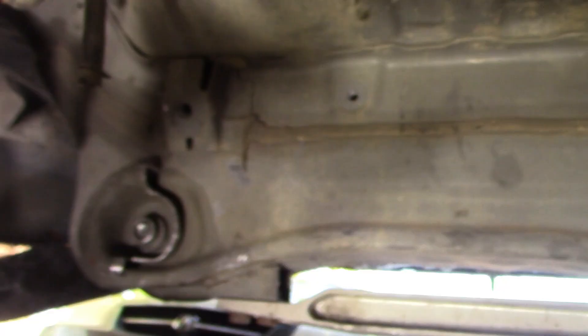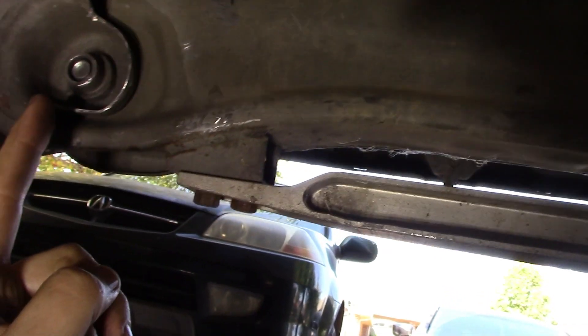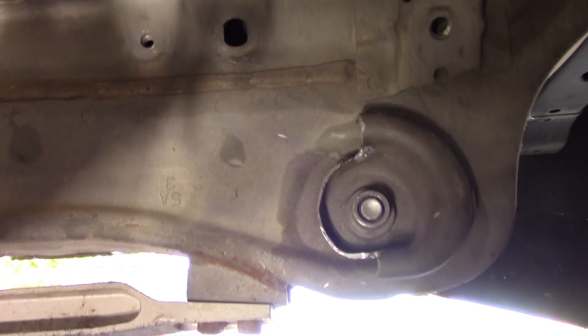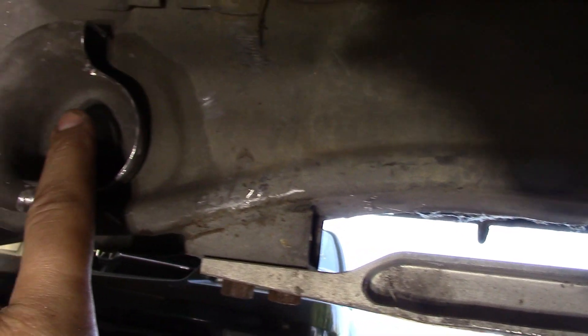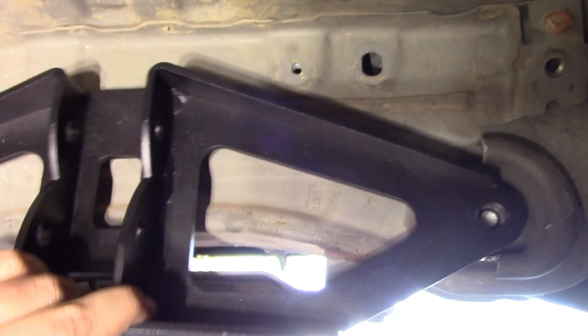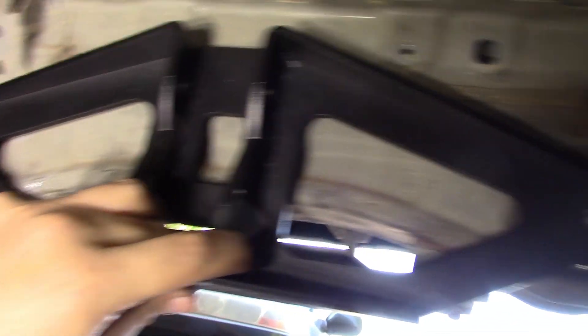The bracket is cut out. When I marked it, I marked it at an angle, but it's a lot easier once you mark it to just cut straight down. You have to make sure right here it's recessed lower than this part, and same thing on the other side - make sure this is lower. Then you can see it fits like a glove without having to beat up the car. I've seen people just chop these off but I'm not really a fan of that.